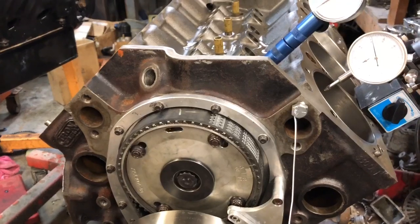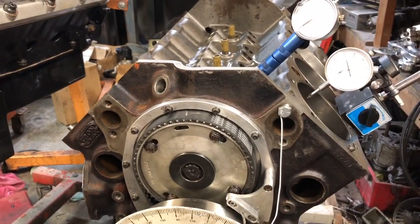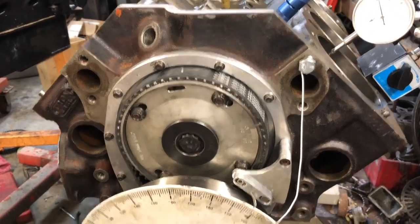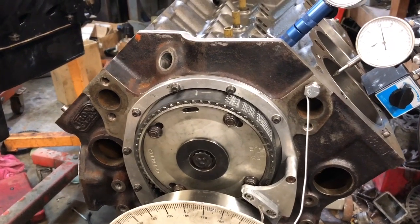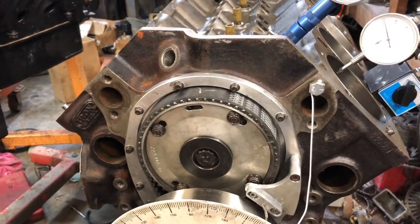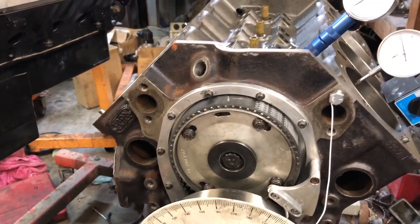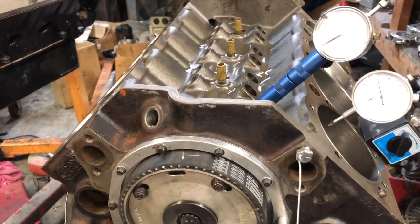I'm going to torque these four bolts down and get this tidied back up. That is how you degree a camshaft in my world — there may be other ways to do it, but to me that is the easiest and least time-consuming way, even though it does take about 30 minutes. Make sure you degree it if you buy a timing set. If you have a timing set that's dot-to-dot with no adjustability, the reality is you might not be able to do anything about it — at that point I'd look at how to make something adjustable. Go with what you got, and if you ain't got what you need, you gotta get it. Alright guys, I appreciate y'all following along — like, comment, share, subscribe. Go fast, get wins. Thanks for watching.